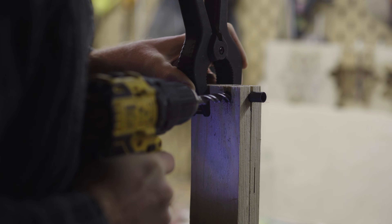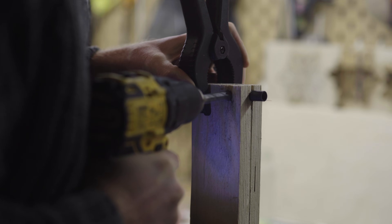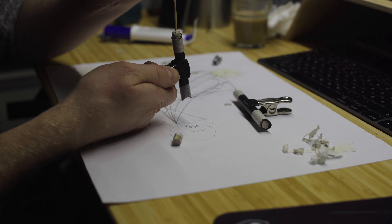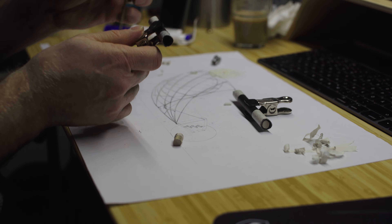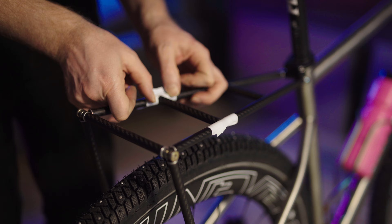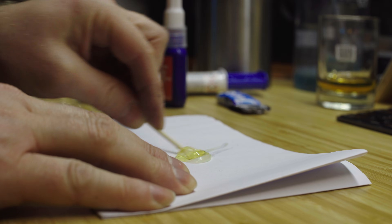Next, the cross braces. I went back to the jig and drilled a 10mm pilot hole on a 9-degree angle, then sanded down the frayed ends. I added a bit of dowel inside the ends of the cross tubes to create a larger gluing surface. Epoxy's a bugger to wipe off, so I masked the areas around the spot to avoid excess, roughened it up a bit, and glued them on.